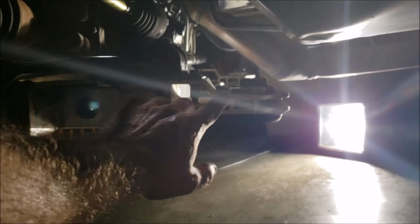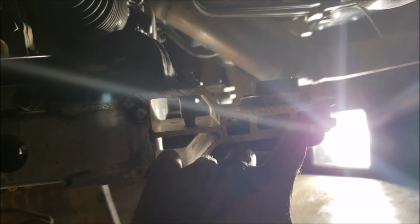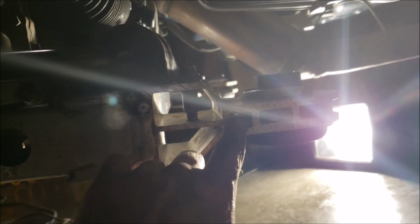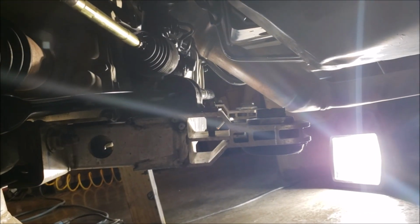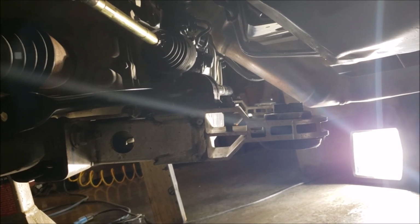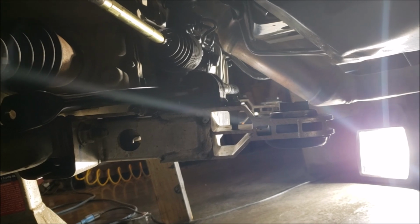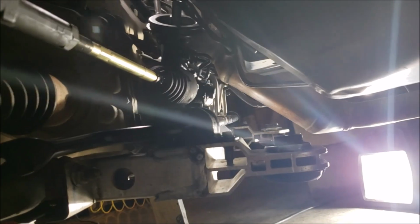And to give you a reference, I dropped mine down to where, if you look at these holes right here, mine measures 12 inches to the center of the holes. Okay, so that's my 2 cinder blocks. And then I dropped that till it was 2 inches of level ground. And that gave me plenty of room to do everything. So, I dropped it. Then I think I finished unscrewing the lines by hand. And I went ahead and popped out those 2 18 millimeter bolts that hold the whole steering gear in.